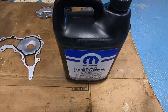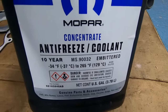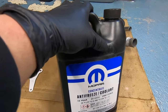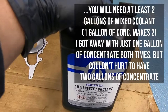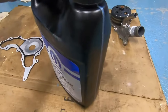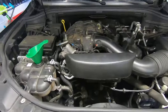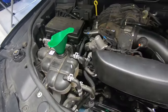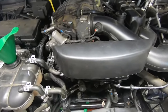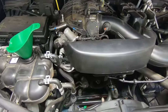Let's get into filling the cooling system up. This is the Mopar OEM 10-year coolant concentrate — keep in mind this is not 50/50, you have to mix it with water yourself. One bottle essentially makes you two gallons, which should be more than enough for this job. I already mixed it — half coolant, half water. We're going to start dumping coolant into the overflow. There are numerous ways you can successfully bleed this cooling system — probably three to five different methods — and the one I'm going to use will work. I already did it once on this job since I had to redo it due to the weep hole failure.